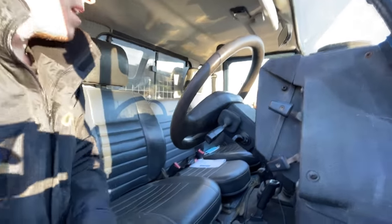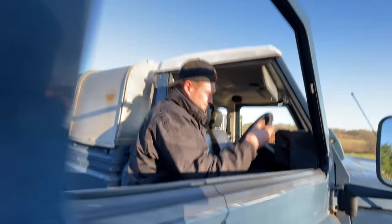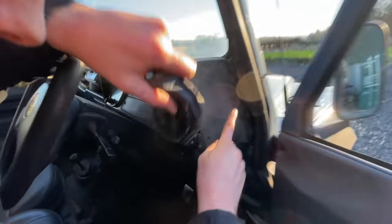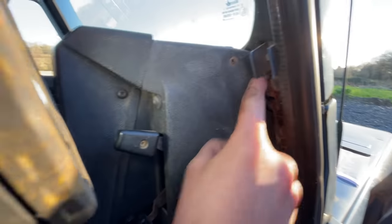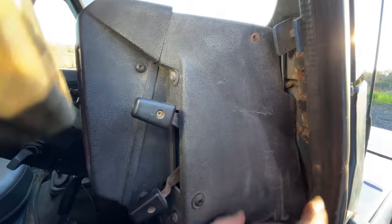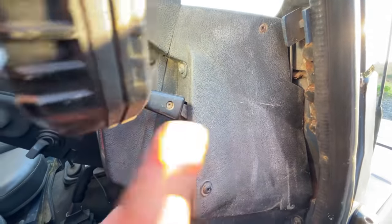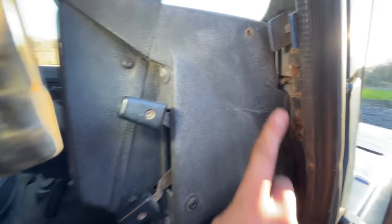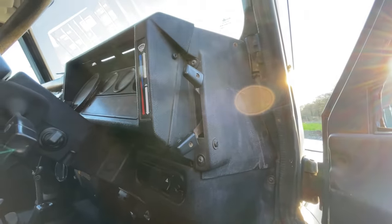This interior is nice and straight and square. On the inside next to the dash is another rust spot between the windscreen frame and the top of the bulkhead. This one looks nice and square down there - nobody's tried to spray black paint to hide anything. Black paint will cover a multitude of sins, so do have a look over all this kind of stuff. No welding repairs to the inside - all looking very nice.